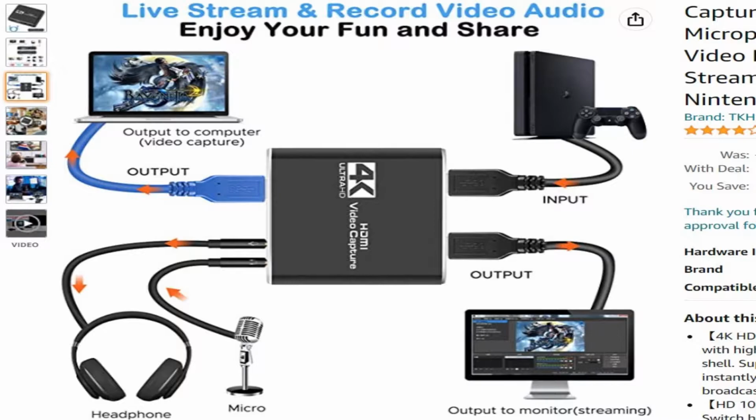You could run your headphones and mic into the dedicated ports on the card to get your audio overlaid with the video, but I prefer to handle my audio input on the PC side through OBS. And for the headphones, it can be handy to plug in so you can hear the audio, but even this you could handle through OBS.